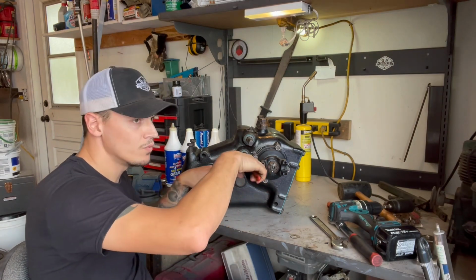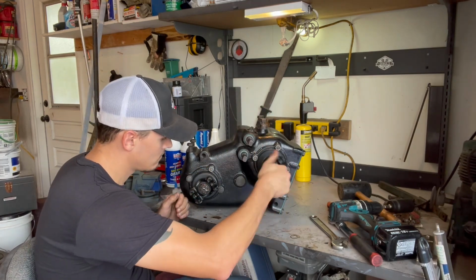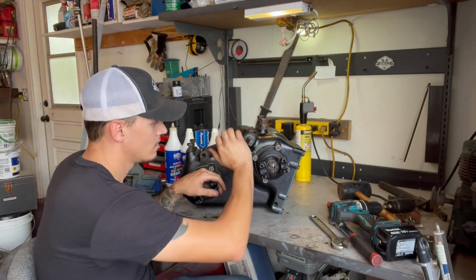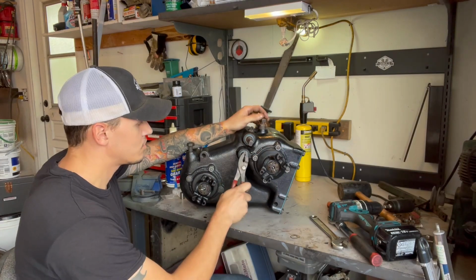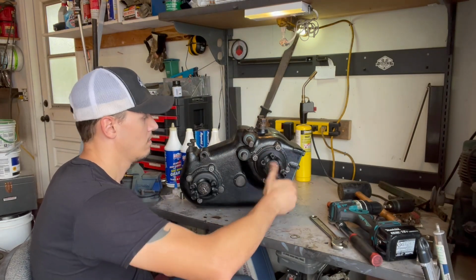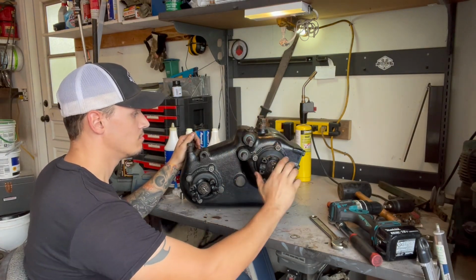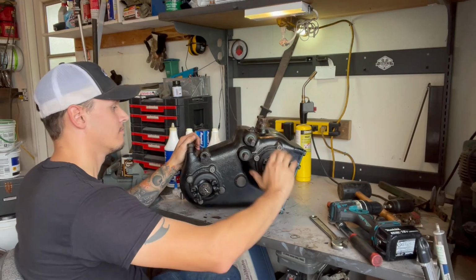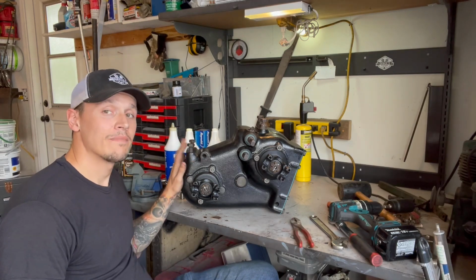All right, we're gonna test two-wheel drive, which is the bottom shaft all the way out, top shaft all the way in. The rear yoke is spinning along with the front one, so that's awesome. Let's try 4 high, which we just had it in, so we know that works. Bottom shaft all the way in, top shaft all the way out, should be 4 low. Awesome. And then one click in, should be neutral. Yes. I love it. And it honestly came out better looking than I expected.